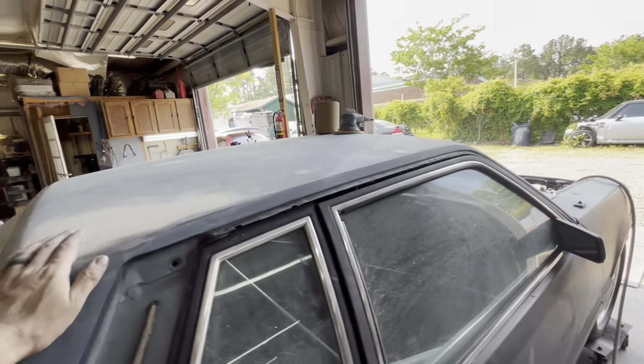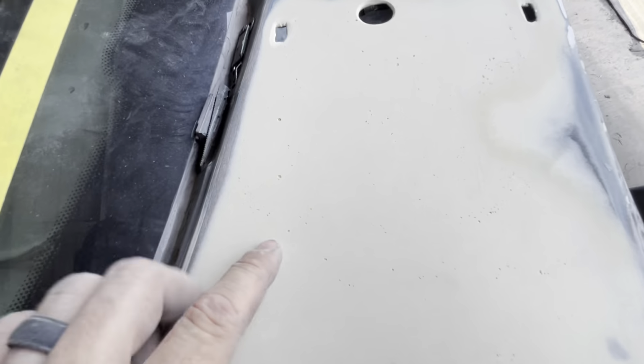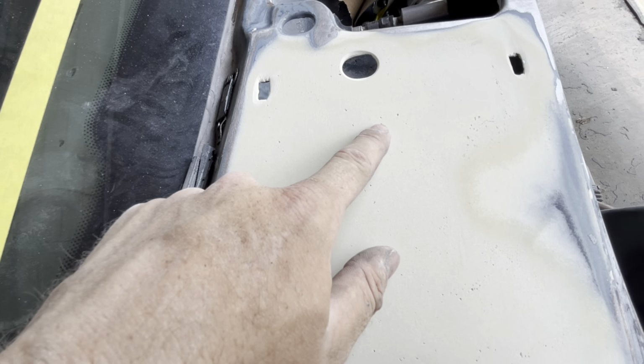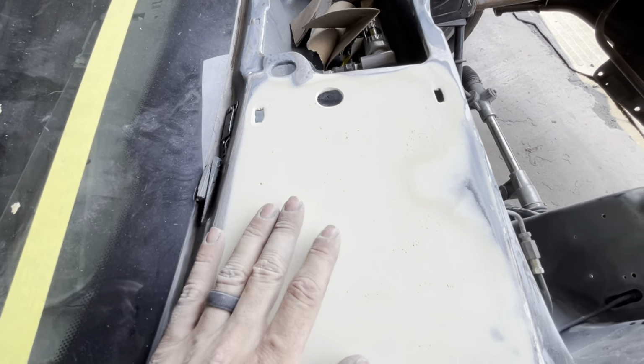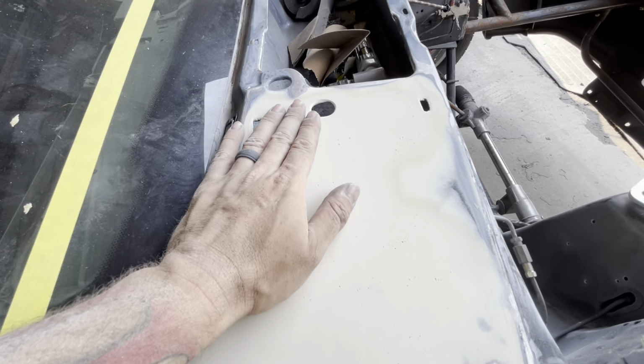All the dents are done, so everything's in the final. The only thing we need to do now is dolphin glaze. Dolphin glaze takes care of these pinholes. All of these pinholes, any professional, if any professional comes on the channel in the comments, they're going to say it's from improper mixing of your filler.